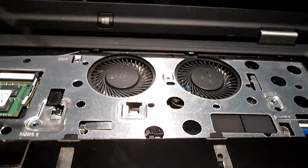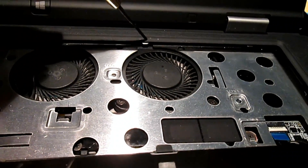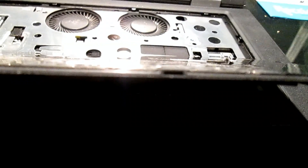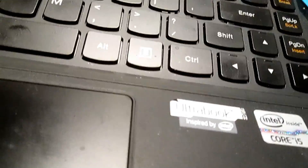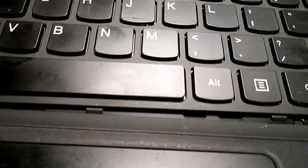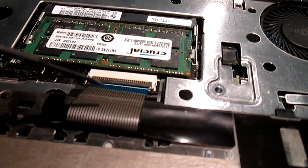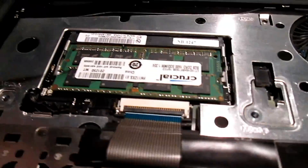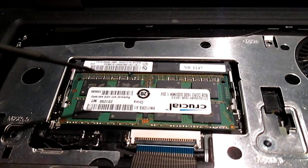Here are the little clips at the back that you depress to release the keyboard. You can see on the back of the keyboard there's the slot that they lock into - so all you're doing is pulling those a little bit to release them; the front slides in. Going back to the connector again, be careful not to yank on the keyboard since you'll be handling it several times. By the way, this is also your memory slot - if you only have 4GB you can upgrade to 8GB cheaply with a new memory module.